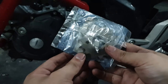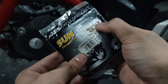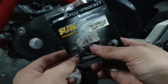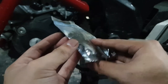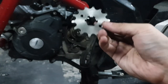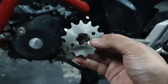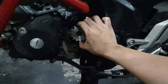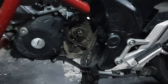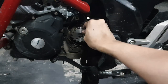I bought the sprockets from Lazada. They didn't specifically say it's for the CB150 — it actually says TMX, CS90, TMS125. But I was reading some of the Facebook group posts and it said it should fit. So here we go. There's the gear — there's the marking that says it's 14 tooth. Will it fit? It doesn't fit. The 14 tooth doesn't fit.